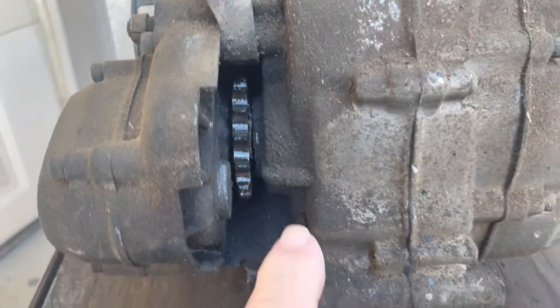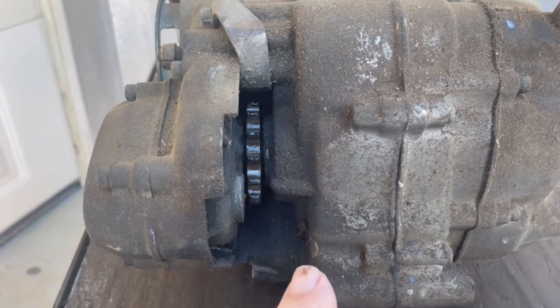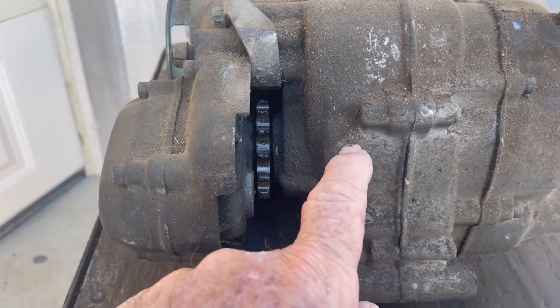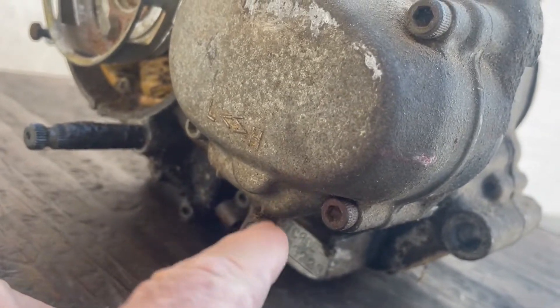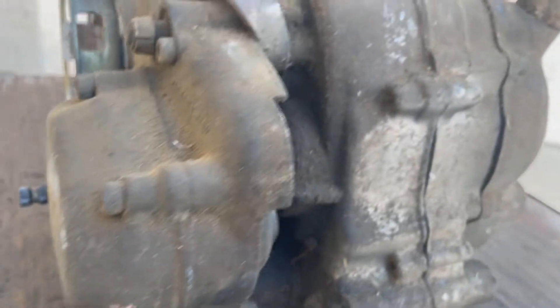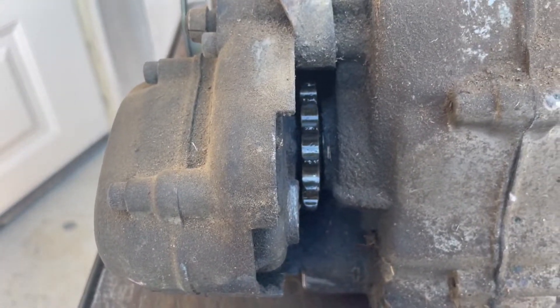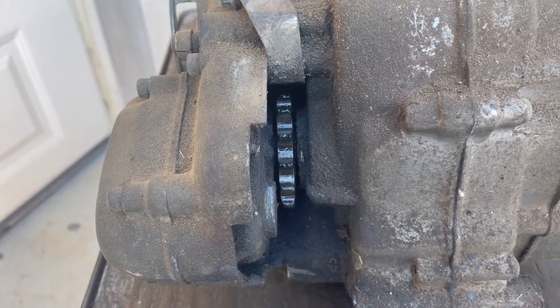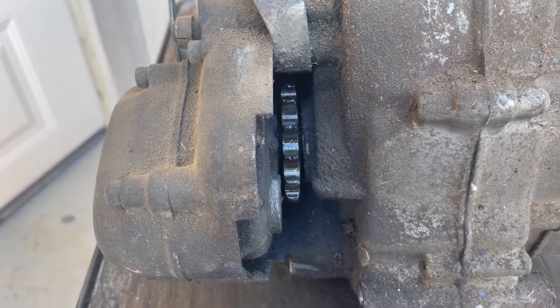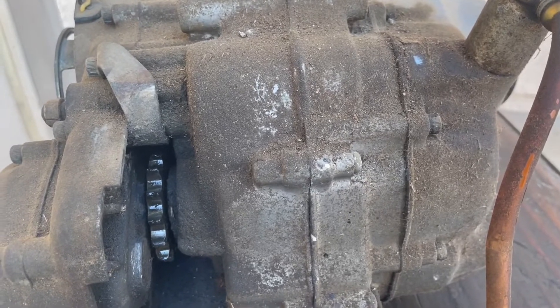There's a funny setup here — the drive pocket for the main drive chain. It's between the transmission and the sub-transmission. The main transmission is in this case here and the sub-transmission is in this case here. It has a little shift lever below it. There's an oil seal on either side of this sprocket and they can leak. It looks kind of wet in there too, so I suspect that's the one that was actually throwing the oil — probably throwing it up on the chain. It's not supposed to be an automatic chain lubricator; it's supposed to be dry in there and you oil the chain separately.